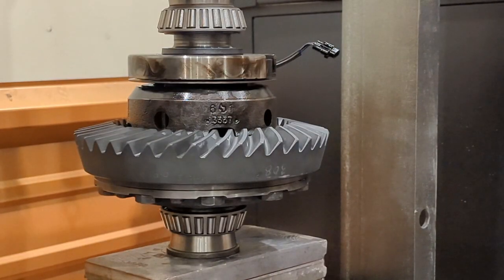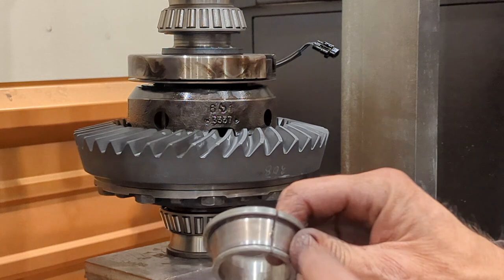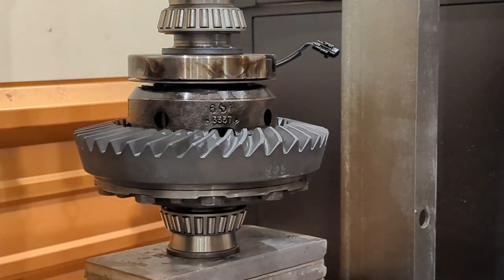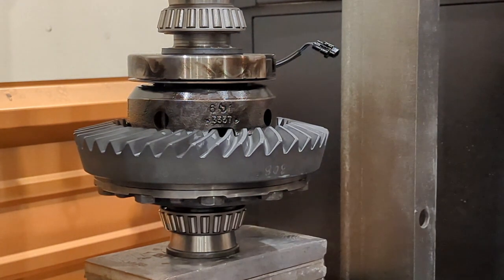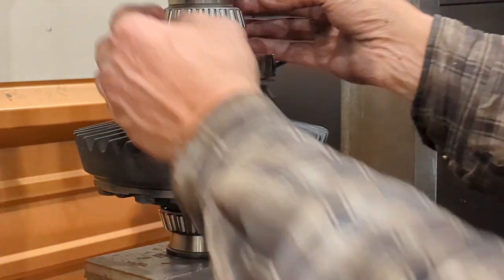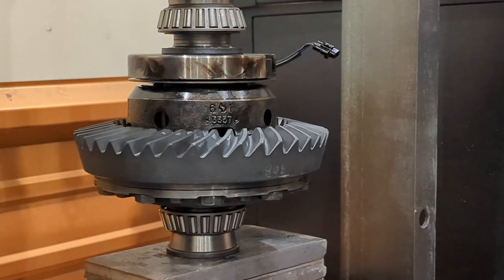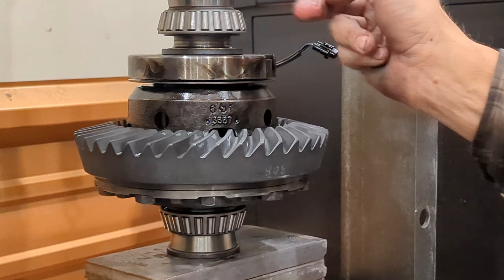You're gonna notice a couple things here. Number one, I have a used cone on the bottom. Remember, I used to cut them off, so I have a bunch of these laying around, and that is designed to push on the cone so this bearing can spin freely. Up top, I have the bearing up here, and I have another cone inverted upside down pressing against that. Now, when I press this on, that bearing's gonna start going, and I should have free rotation down there and up here.